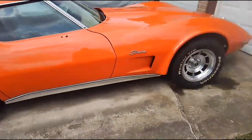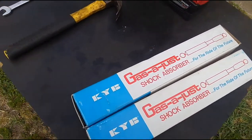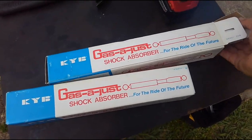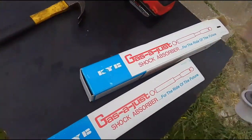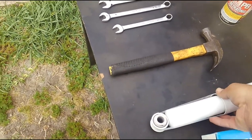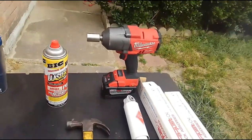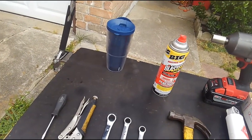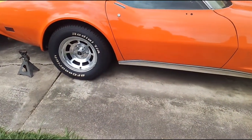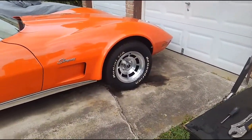Today I'm going to change the rear shocks. I went ahead and picked up a pair of KYB gas adjust shocks for Corvettes. The good thing is these are actually really easy to change on the Corvette — one of the few lower suspension items that won't make you pull your hair out on these C3 cars. They've literally got just two through-bolts, one on each side. As long as you're not seized up, we should be in good shape. Basic tools are required, plus a little penetrating fluid and an impact. I'm gonna grab my impact and the jack, get this rear tire off, and show you guys where the old shocks are installed.